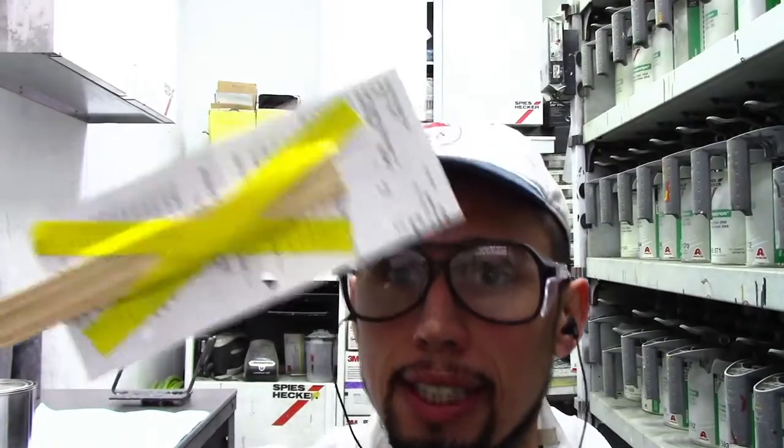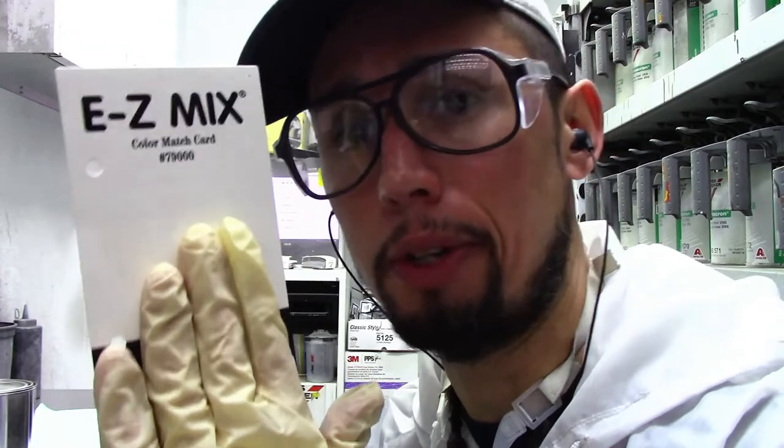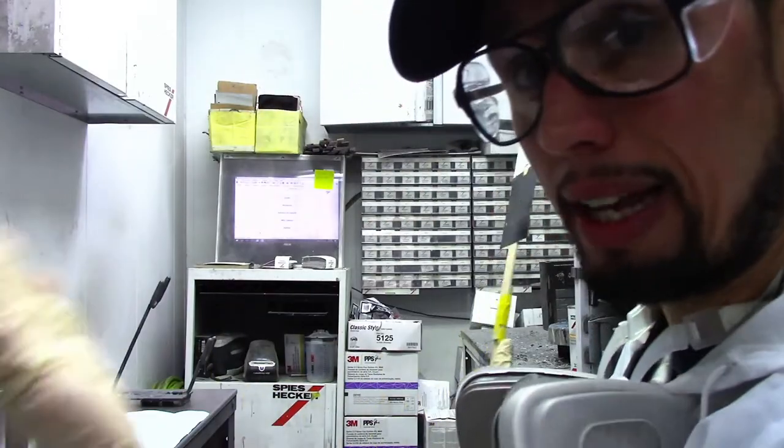I want to explain why I stick that sticker on here. When you put the sticker on, you'll always know what variant you sprayed on this panel. That way, if you get another car of that make and model, or another car with that color code — most makes like Kia, Honda, whatever — use the same color on multiple different cars. You want to keep this panel and make sure you have the variant on it so you can always go back and check it. If you're painting all the time, you're going to have the same color come up a lot, especially if you don't have a mixing system like I have.